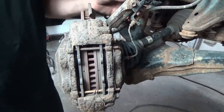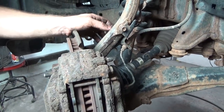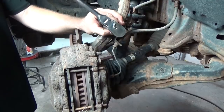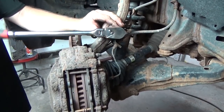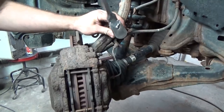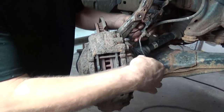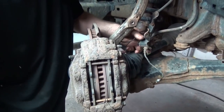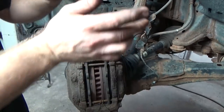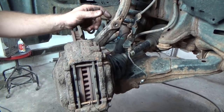She's actually all the way out. You can either just pop that metal clip out, or you take and remove that retaining bolt. If it feels like it's going to be too much of a bear, you do not want to break it. It feels like she's going to be just fine — A-OK, 12 millimeter. So what that just allowed us to do is remove the brake line out of the way without manipulating it, because we're going to come back here at a later time and revisit these brake lines.